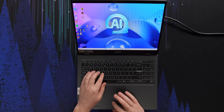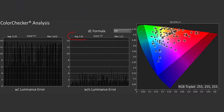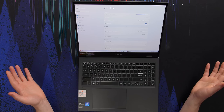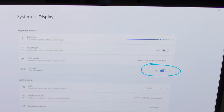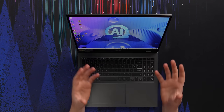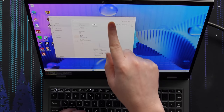But if you just turn on HDR, that just looks way better. So you enable HDR and it's quite accurate in HDR, right around that Delta E of two that we expect. But turning on HDR also makes it way more accurate in SDR for some reason. So there's not really any reason to not just turn on HDR in Windows, because then the color mapping of this display in all of your content is just way better. Why that is, I don't know, but it's just one click and you're good. Also, the peak brightness of this display is 600 nits, so that's bright enough that you might be able to go outside and work on this, although it is quite shiny and really it's an OLED. So where it's really going to shine is in dark rooms where you can see those completely black blacks. No touch screen though, that's unfortunate.